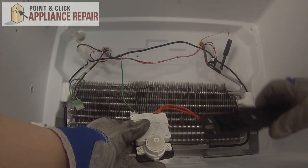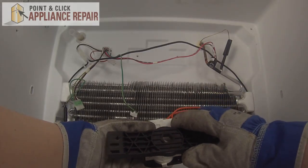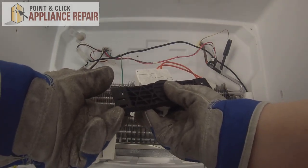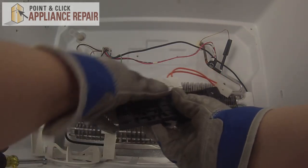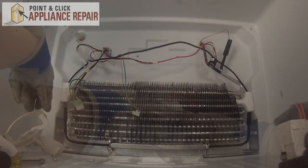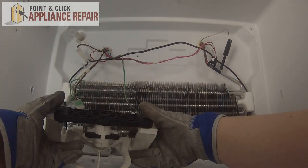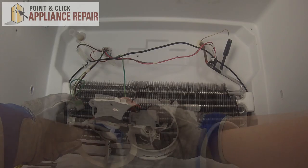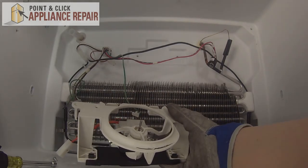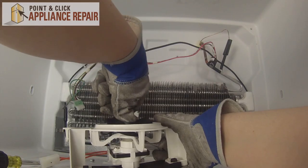Now we can take our motor and the black bracket that goes on the back. The wire harness should be at the top of the motor. Line up those hexagon shapes. The clips should also be facing away from you, on the bottom, with the screw holes at the top. Once that fits snug on the motor, next we can take the front of the bracket, line up the shaft of the fan through the front of the bracket, and clip the back bracket into place. Make sure to line up the front of the bracket with the grommet. Now we can press our new fan blade onto the shaft — it's a pressure fit, so just make sure it's all the way pressed down.